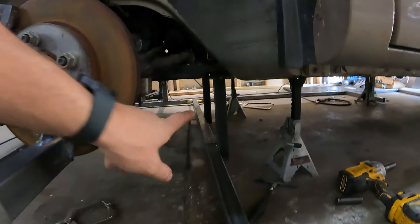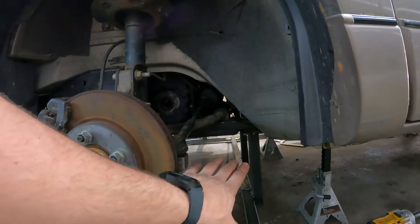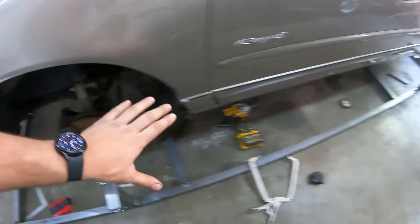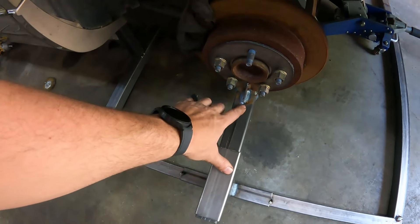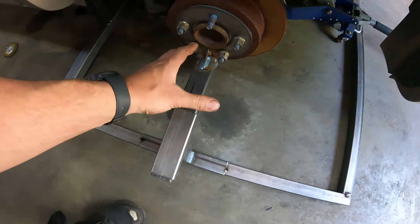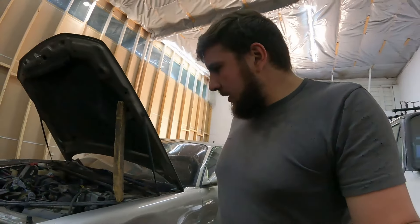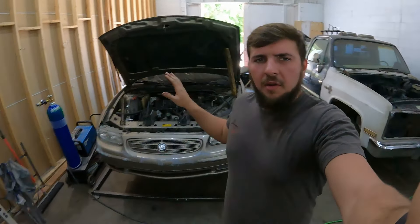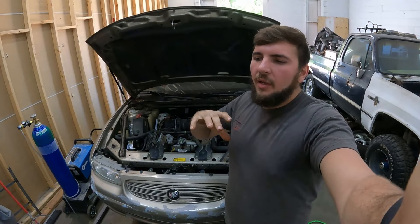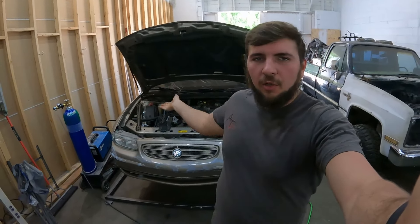This jig is to help put the wheels where they need to be — it literally attaches to just the rear subframe mounting points. It's going to be tricky to get removed with the factory subframe in here, but I had to design it so everything was placed properly. It's not load bearing, not structural. I made these things so they can slide, with a pin or two, because the Mustang's rear track width is a little bit wider and the front might be a little narrower. We're going to turn this engine in the right direction and try to capture the vibe of what a Buick Grand National was — a Regal with a turbo 3.8 in it.